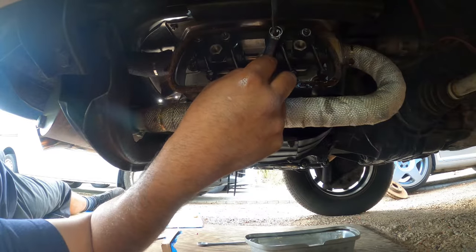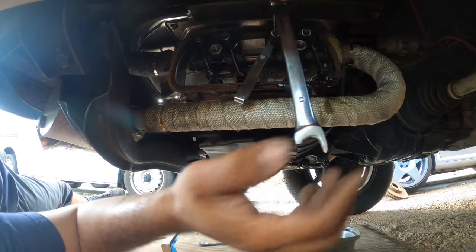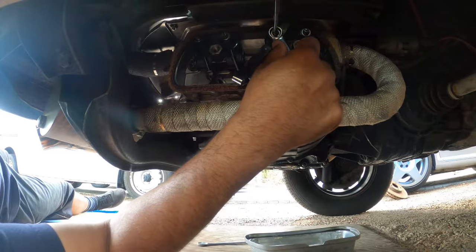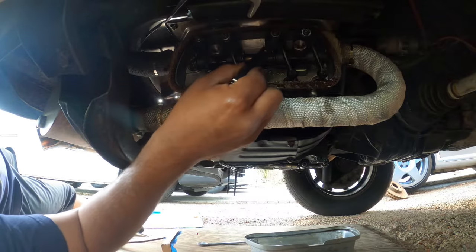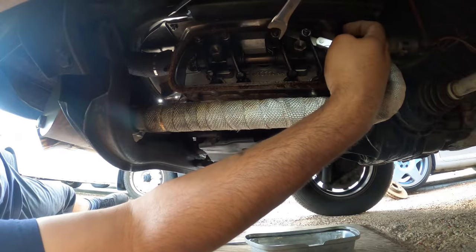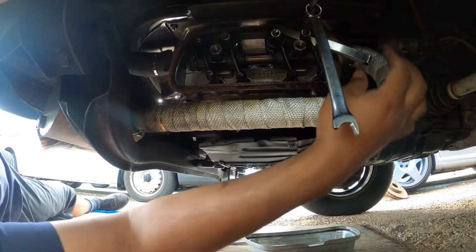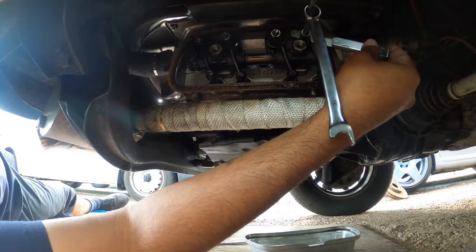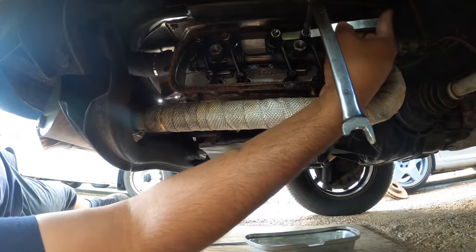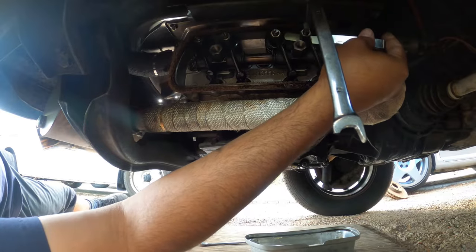What you're going to need to do — focus on this — don't allow the bolt to turn besides the nut, because if not you're going to mess up. You'll see here we've got a little bit of resistance and a little bit of smooth play — that's what we're looking for in adjusting your valves. Over here, no resistance at all — sloppy, no bueno. Same procedure — feel for that, then too much resistance. You want it to be able to slide a little bit. That's what we're looking for: a good slide but with some friction.